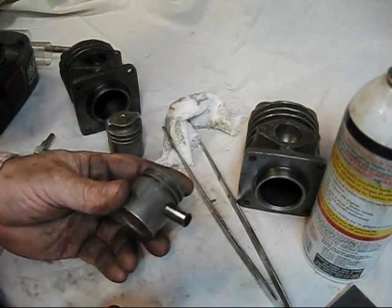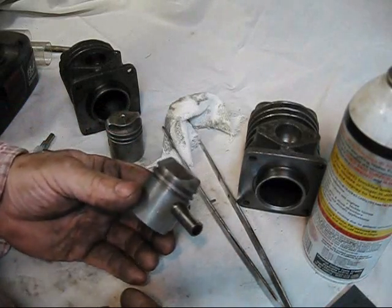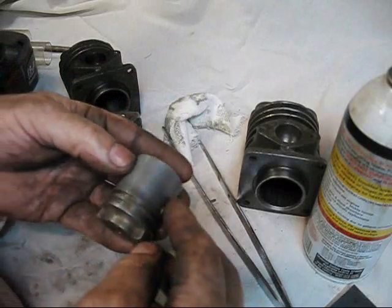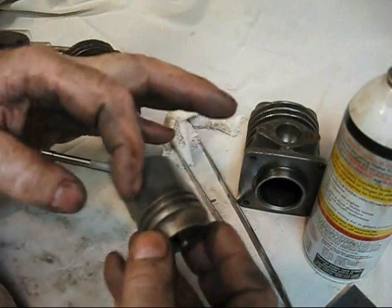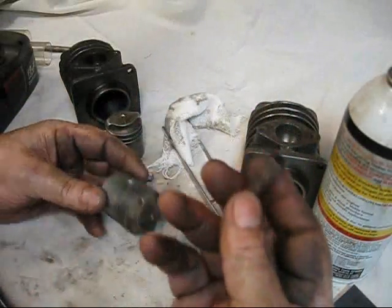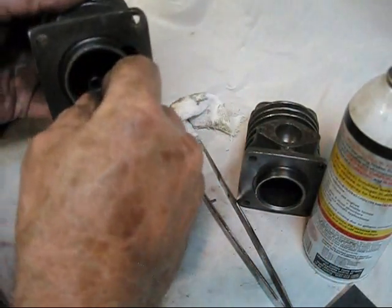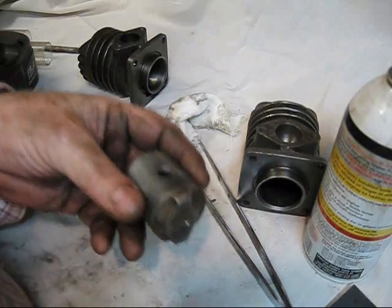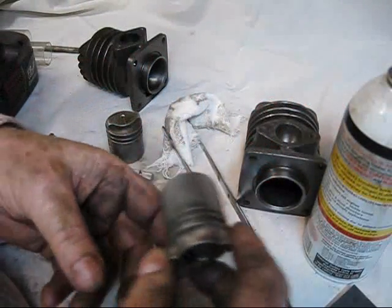That is a floating wrist pin — it's not a pressed fit. This wrist pin is in the engine like so. As long as the engine is on level, that wrist pin has no pressure to the side. Now if you turn the engine sideways, you would have the weight of this wrist pin resting on the bottom side of the cylinder. That weight would wear a groove in it if the engine was turned and run that way. But in its normal operating position, there's no pressure to wear the side of the cylinder — it just floats in there. That's the way it's supposed to work.